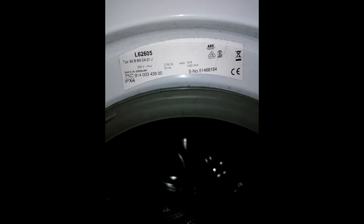The machine gave the error E70. If you look that up on the internet, it says temperature sensor failure. But you have to ask for more details by pushing some buttons and you get the error E74. That is also related to the temperature sensor.